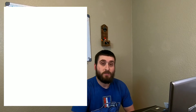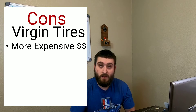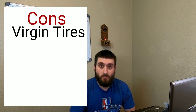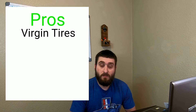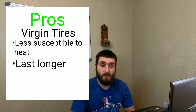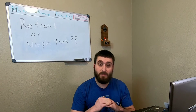For virgin tires, the main con is that they're expensive. Also, if you puncture a virgin tire on the sidewall or get a hole too large to repatch, you lose that money. The pros of virgin tires are that they're less susceptible to heat — since they're made from scratch, the cap doesn't tend to peel from the casing. It's all one molded piece, so they last a little longer and wear better since the casing and tread cap were designed together.